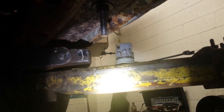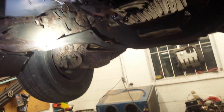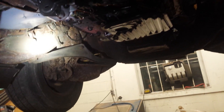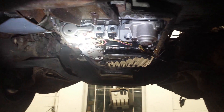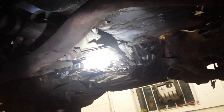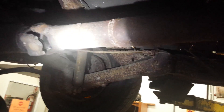I'm going to put the pan back on and fill it full of fluid — lesson learned that that plug is what you've got to have and leave in place. I've got one more body mount to do and then I should be fixed up. This is the 4L60 transmission, which is a little bit longer, so we had to do some driveshaft modification — we had to cut it and sleeve it.